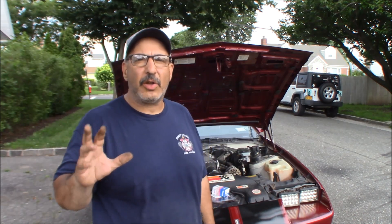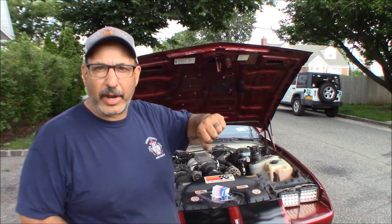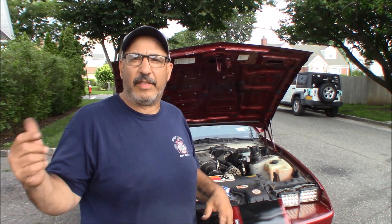Hey, it's Rob, welcome to Axel's Garage. We are out here dealing with the low brakes in my wife's IROC. There's a little something going on — when we were swapping masters and bleeding, going through everything we could possibly go through, I did happen to touch the brake booster hose and realized that hose wasn't on tight at the end of the check valve, and it affected the idle.